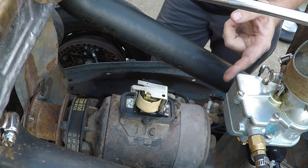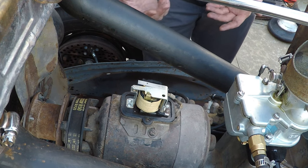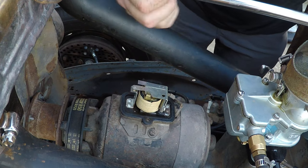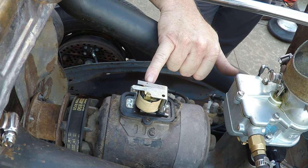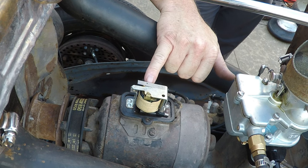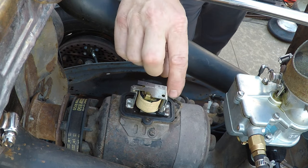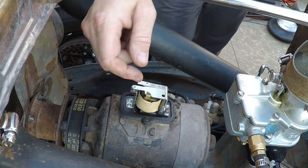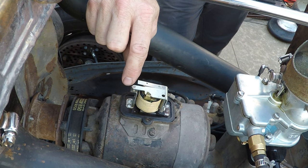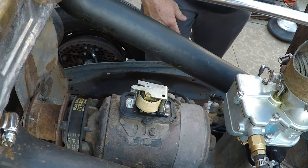That's the one that came on the motor so I'm going to use it — it works fine, nothing wrong with it. You can adjust the depth here between the plate and the top of this coil, and that really needs to be set at about 15 thousandths. This one has a couple of screws for adjustments that slide up and down, and then you make your final adjustment with that little arm by bending it to get down to 20 thousandths on that contact. Pretty easy, pretty straightforward.